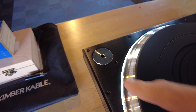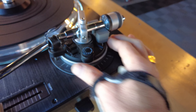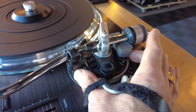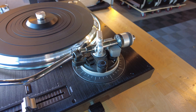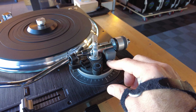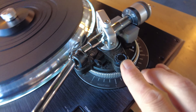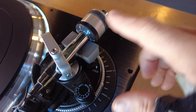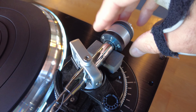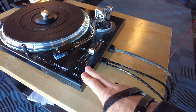It's got a little adapter for 45 records. The tonearm is pretty simple — it has the same sort of adjustability to raise and lower the tonearm through a knurled adjustment, which is really nice. I fit tonearms almost on a daily basis and they're almost always a pain to set height for, but Technics and Denon have done a great job giving you just a twist action for height. Antiskate is set right here, nice and easy, and tracking force is set with the counterweight. It has a scale to help you set tracking force — though I highly recommend a digital scale, about $35 on Amazon.